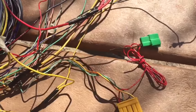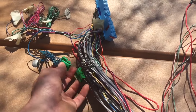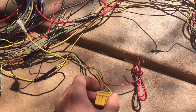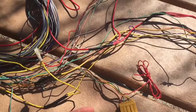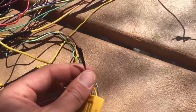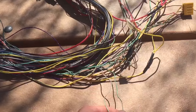Next up — the select monitor and the test mode connector. The test mode connector we'll just wrap up toward where the other test mode connector is right here, leaving it in this general vicinity — no soldering or crimping needed there. With the select monitor, it has the same red wire the OBD2 had, so we just cut it about two inches and leave it where it is. On all cut wires it's a good idea to insulate them, so I just wrap a little electrician's tape around them.